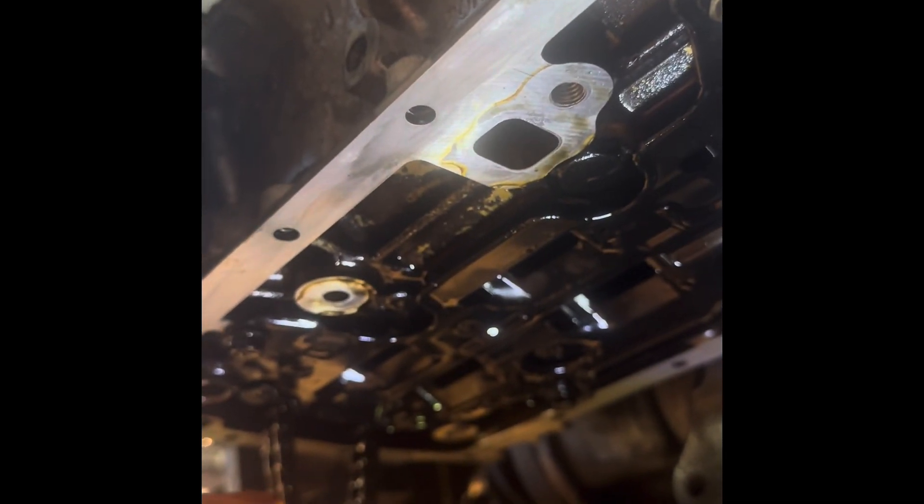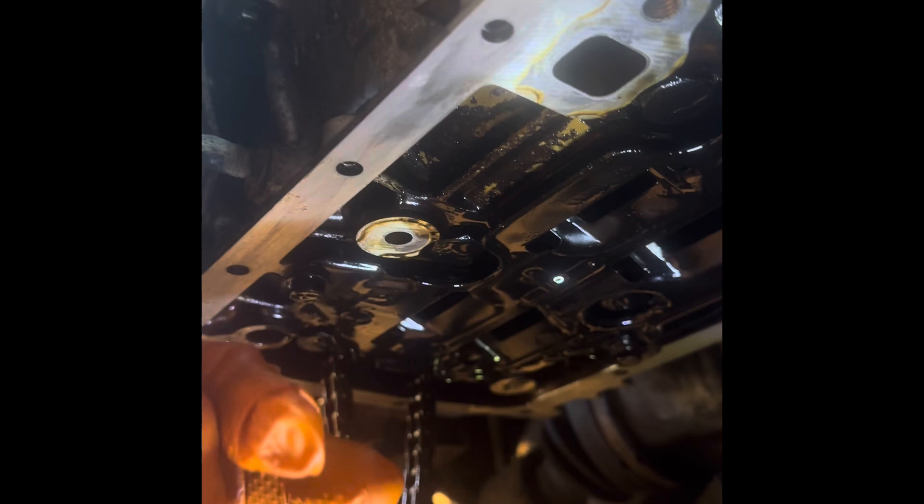So straight to the point. I've left that chain on there because I want to put the old cam chain sprocket and everything back on, because I need to turn the engine over. At the moment she's locked in the middle position for taking the head off and everything.